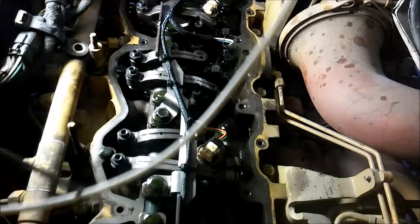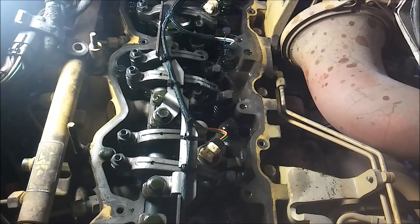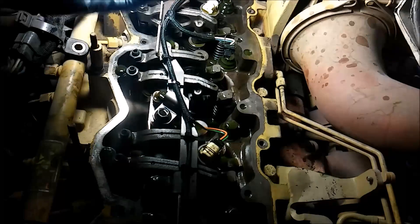I'll give it a good few seconds of purging it. This is just a little vacuum setup I use on all my injectors just to clean the bore out. Once the injector bore is good and clean and the cylinder has been evacuated, you always want to look down the injector bore and make sure there's no pieces of O-ring or something that has fallen in it while you've been working on it. That's the last thing you want is to get something down that cylinder.